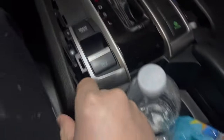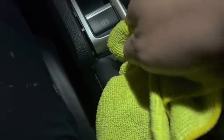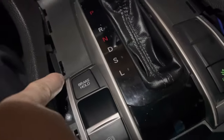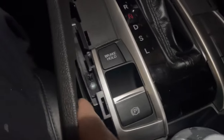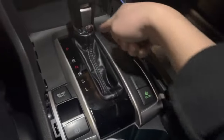Since I don't have the right trim removal tools, I'll be careful. I take my flat head screwdriver and pry from here — you can see there's a space right here. I may make a small mark but that's okay. Here are the clips: one, two, and all the way over there. Here are the screws — one and two. We're going to remove these screws and then the whole assembly should come out.